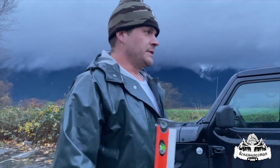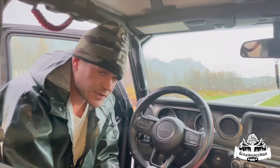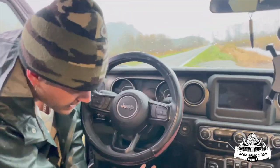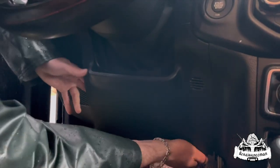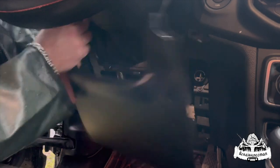Let's go inside here and calibrate these bigger tires. Our factory tires are 31 inches — these are 33, so we do have to calibrate. First things first, hook this cord up. We've got to get to the plug up under here. You're going to pop this panel off — just give it a little pull. It's kind of scary at first because it feels like it's going to break, but just give her a yank and all these will pop off.